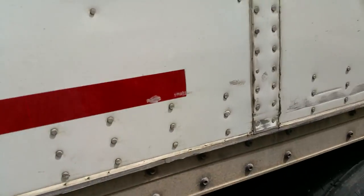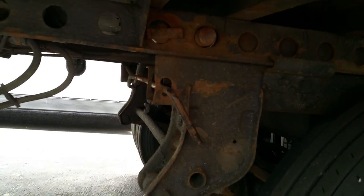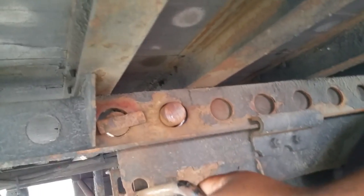There will be times when you pull the tandem bar and it's not going to go all the way like it's supposed to — and this is why you need gloves. When that happens and the pin doesn't fully release, you have to get in the truck with your trailer brakes locked, pull forward a little bit, come back out and pull again. You have to get it just right sometimes with a lot of these trailers in order to slide the tandem.